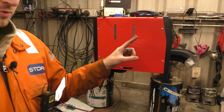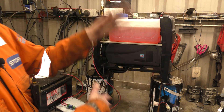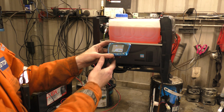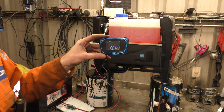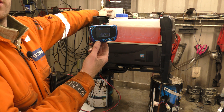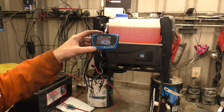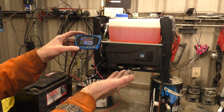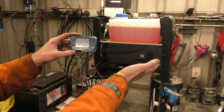I need to test if that's purely because we're on the afterburner, or if it'll do it on a normal controller as well. So I'm going to unplug the afterburner and plug a normal controller in. The other controller is in now, it's running. I'm going to do the same thing again and hopefully see what happens when we switch over to battery power. Ready? Three, two, one — it does the same thing. Browns out, power drops, the heater just stops fueling basically, and is now running a cool-down cycle because it's still red hot as you can see on the display.